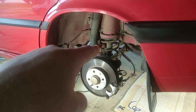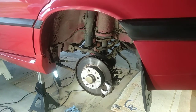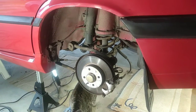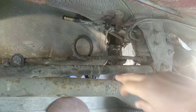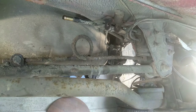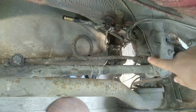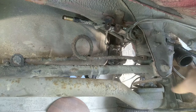The regulator is down on the suspension, and when the wheels are all the way down — if you have the car on a lift or on jack stands like it is today — you may have not enough fluid passing through your calipers, or none at all. Here you have your regulator, and it is connected by this spring to your panhard bar. What I will do, because I have to disassemble all of my rear suspension, is actually disconnect the panhard bar and lift up this spring to push in the regulator so we can have fluid come out to the caliper.